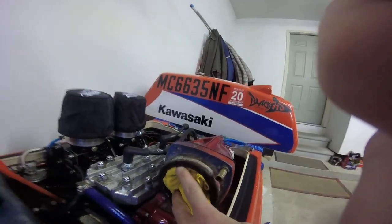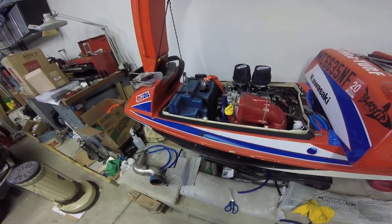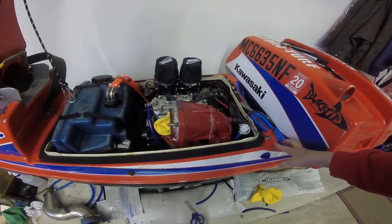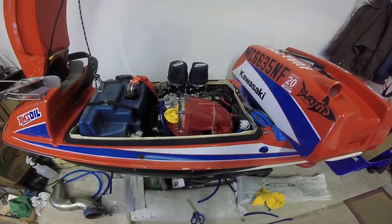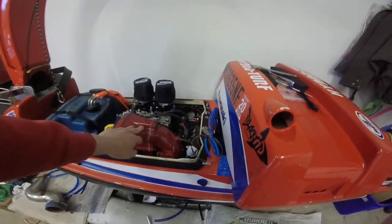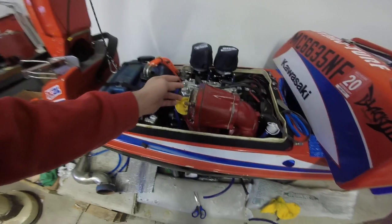That means that the water can get through there, get into the pipe, and then up the hole through the chamber. I haven't actually gotten to ride it since then, but I wanted to make a video showing the hole because it's so small. I actually posted about it, and a guy on the page also has one of these half pipes that he was about to throw on, and he didn't even notice his hole either because it was completely clogged too. So I think it's not talked about at all, really. When people have issues with running these half pipes, it's always either the gaskets or the hole inside of the expansion chamber. So that was a good find.